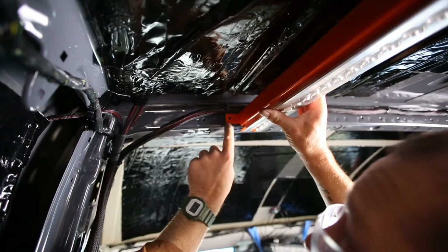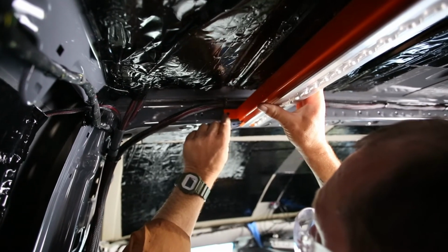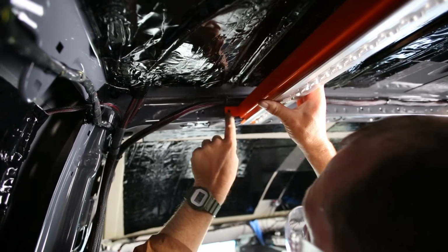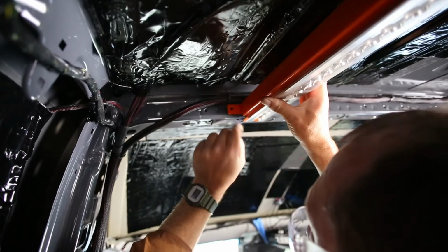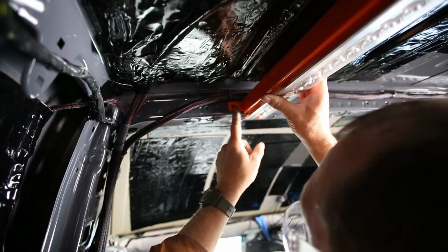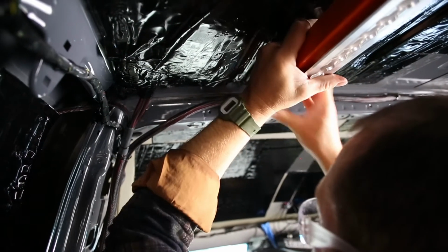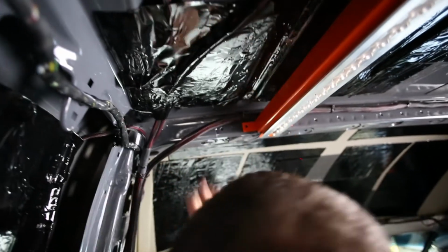And again, through bolt it if you're cutting into one of these holes. With this one, we got lucky as well in that the entire OEM hole is within that perimeter. So you can set a rivet here. It's only when the circle is halfway open that the hole you punch is going to be deformed. So we're going to go ahead and set a rivet there too.